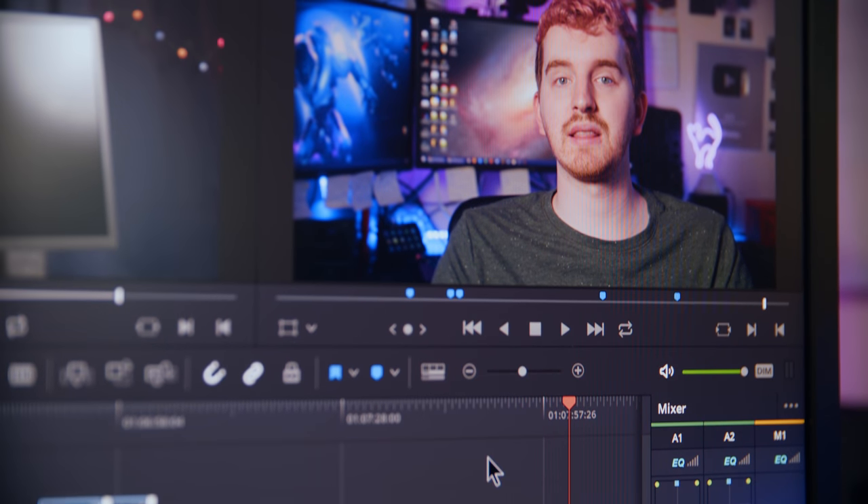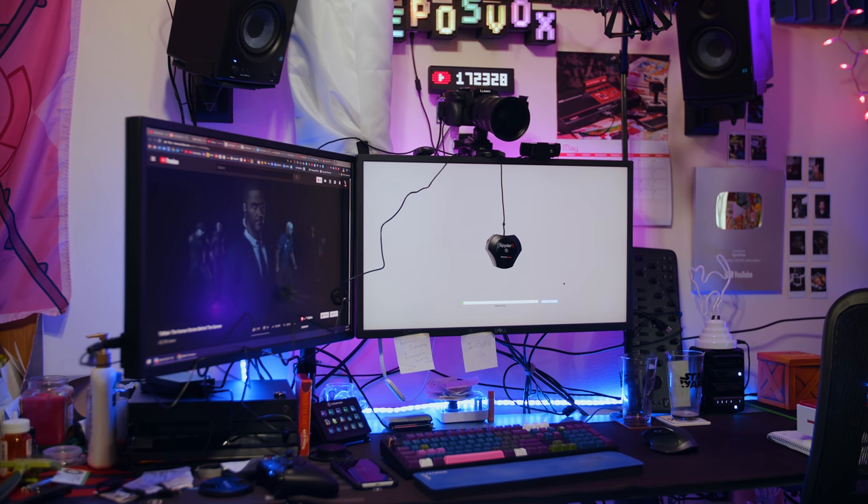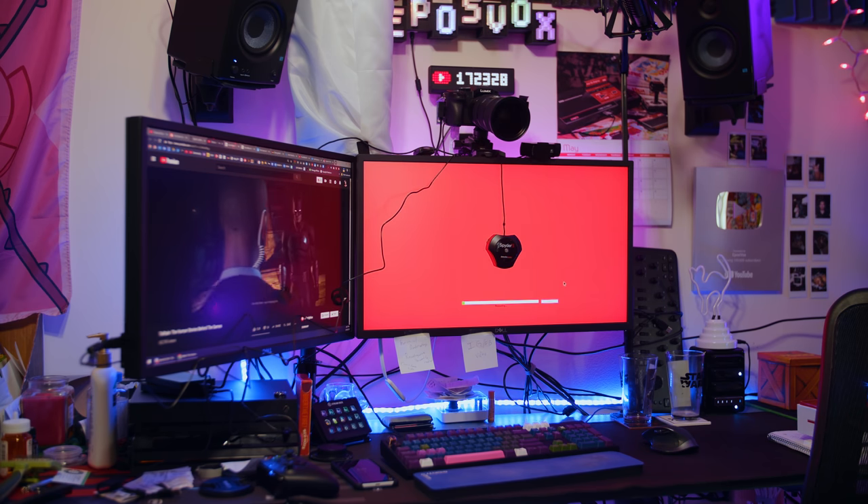The big selling point of monitors like these is their super sharp color accuracy, color and bit depth support, and color space support — being accurately calibrated with a delta-E of less than 2 for AdobeRGB and sRGB right out of the box. This monitor supports full 10-bit color, and yes, that even works on some GeForce cards despite common belief, including the 1080, 1080 Ti, 2080, 2080 Ti, newer Titans, and so on. It supports 100% coverage of AdobeRGB, sRGB, Rec.709, and 97.7% of the DCI-P3 color space, and 76.9% of Rec.2020.